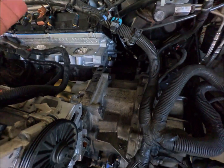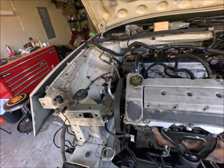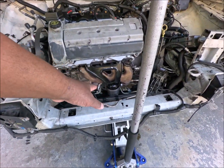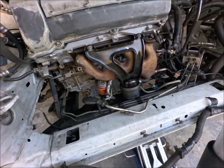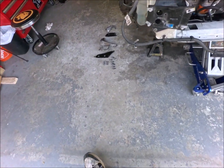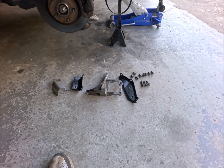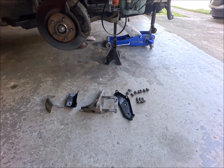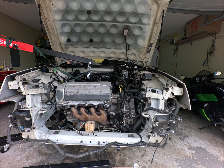What's stopping me from taking this motor out now: there's an 18mm bolt here, here, and here, and a 15mm bolt down there — I don't know why it's 15. The bolts on the bottom are off. I just need to jack it up and take this motor mount; it's got a bolt here, a bolt here, a bolt at the bottom, and two bolts into the side of the motor. I made this video to tell you about the brackets. If you don't put the brackets on — this thing's got a lot of torque — I'm not going to find out what happens.